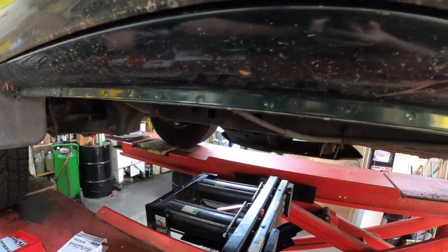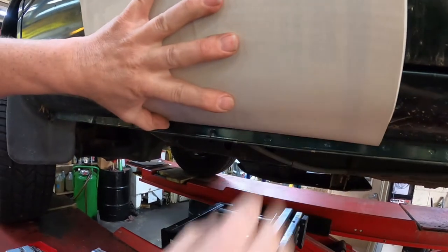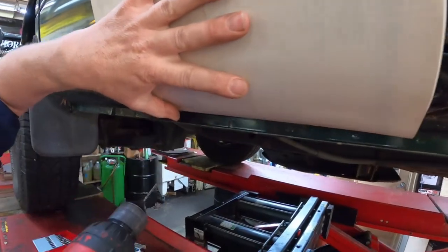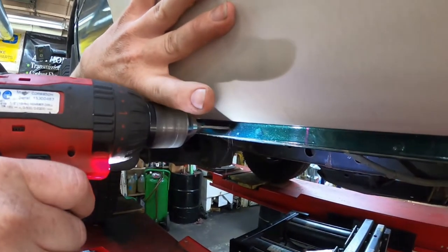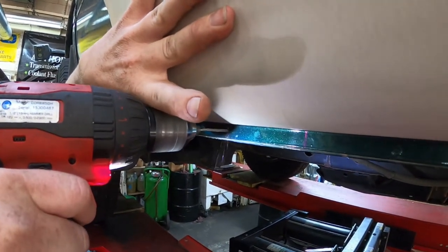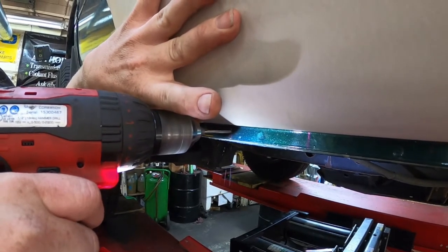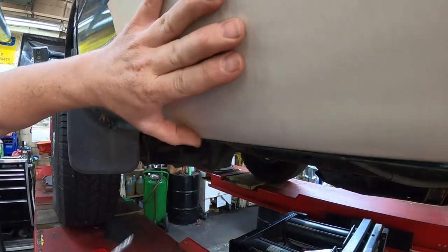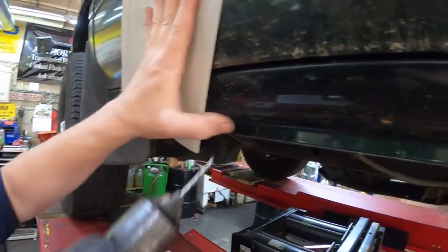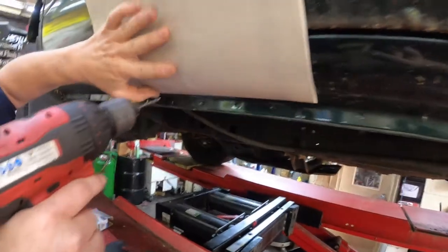The tape ended up missing. You should tape this area up here, so when the drill falls through, it doesn't scratch the paint. So I got myself one of these really thick fender covers that I use. So when it goes all the way through, the arbor won't hit and screw up his paint. Okay, let's do the next one, same thing.